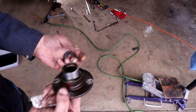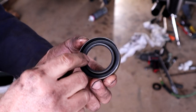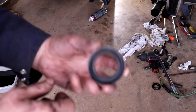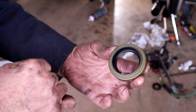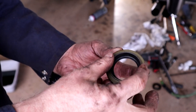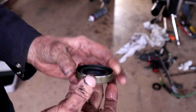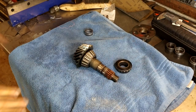The nut goes on and once that's torqued, that sleeve gets peened in. Here's the normal pinion seal — this end goes in towards the differential, and there's a little retaining spring around there. You're supposed to coat this with some oil so it slides on nicely and there's no chance of the spring popping off. The measurement across here is just shy of 50 millimeters, so I'm going to get a 50mm socket that sits plum on there and gently tap it in. There's a chamfered leading edge to help it go into the carrier housing easier.